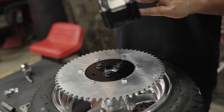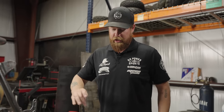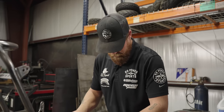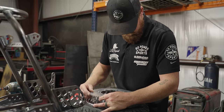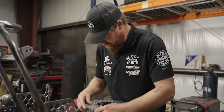These are the 3/8-inch bolts for the sprocket. On all these split sprockets, you should always be able to match up the number. These are going to be a 7/16ths head. Try to get your sprocket as lined up as possible — there's a tiny bit of play in these. Be careful about over-torquing because you're threading into a billet aluminum carrier, so you can strip out those threads. If you don't have an adjustable impact, definitely use a wrench.